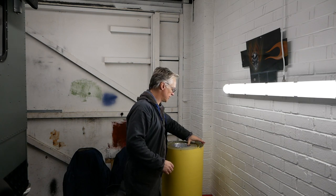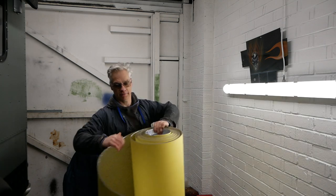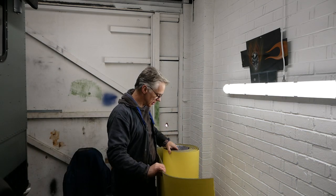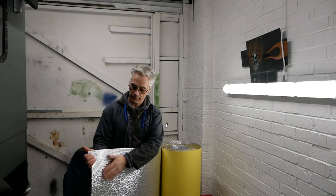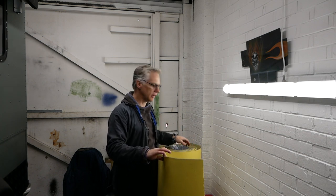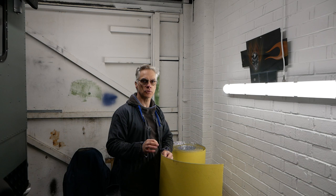I've escaped from the wiring in the back for a bit, so I'm going to start putting this insulation on. Now this insulation — you've probably seen it on the doors already — it's closed cell neoprene and it's self-adhesive with a reflective surface, so it reflects the heat back into the truck. It's waterproof, it doesn't absorb moisture. It's brilliant — I've used this stuff for years. Not only is it good at insulating, it also kills the sound — it's sound deadening material as well.